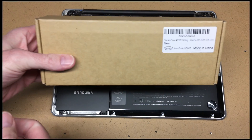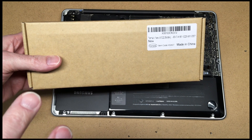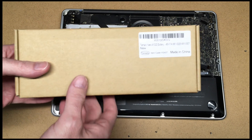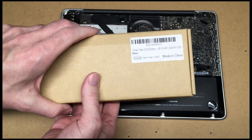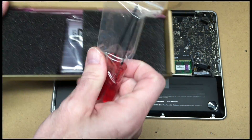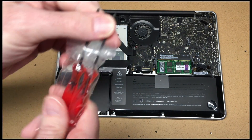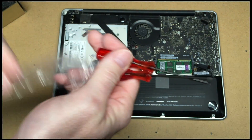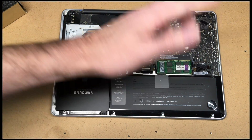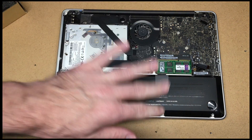What I'm going to be doing is installing a new battery. I ordered this on Amazon — I'll put a link in the description — and if you use my link it'll help me out a little bit through my Amazon affiliate account. It comes with two screwdrivers: a Phillips to open the case and a tri-wing screwdriver. I did take the old battery out and put it back in temporarily for this video, but I ran it without the battery and it worked fine.